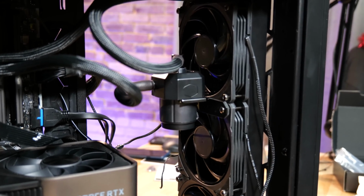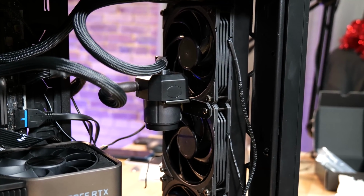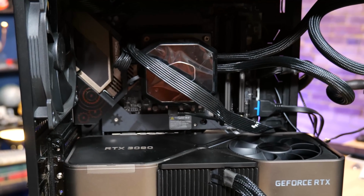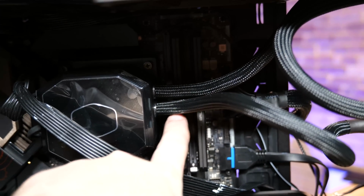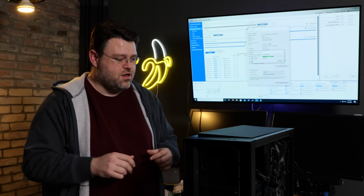And the rest of our setup, other than the ASRock Taichi motherboard and the 10900K, our memory certainly helps. It's DDR4 4000. This is actually from Crucial. It's Crucial Ballistix. I'm going to be including that in another video, kind of a head-to-head shootout of fast memory. It's clocked fast, but the timings are kind of loose. Like timings versus the other stuff, how much of a difference does that make? There's kind of a lot to that. That's a story for another day.